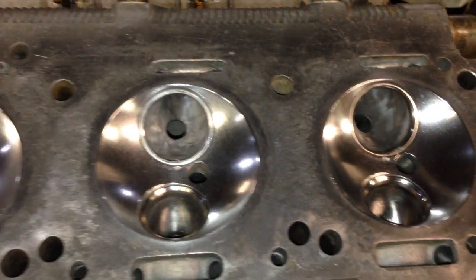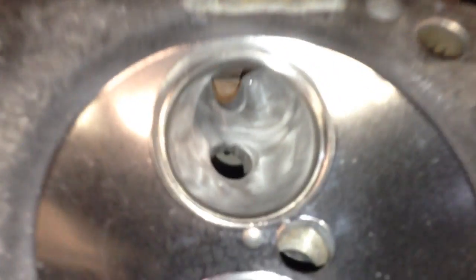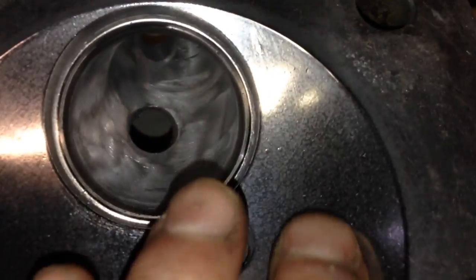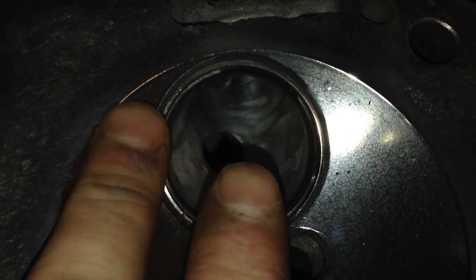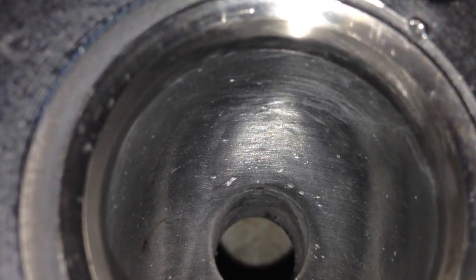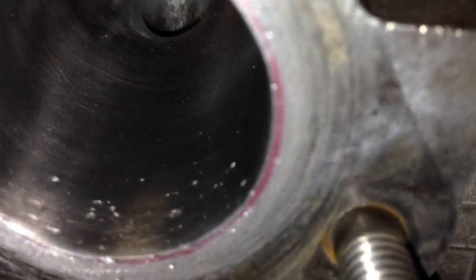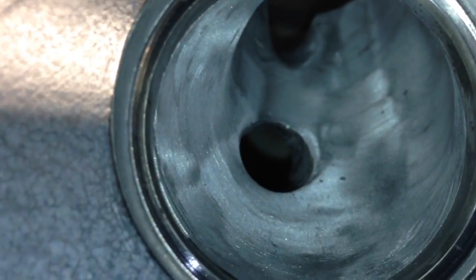Head porting and refinishing is all done — took a long time but finally it's behind me. I may do a little bit more work on those combustion chambers to get them a little more shiny, but they're good enough. The exhaust ports are finished with one of those scotch-brite buffs, so they're fairly clean and shiny. Combustion chambers look pretty good except for one where I found a little bit of detonation pitting — not really any big deal. Intake ports are finished as well and I'm pretty happy with those.